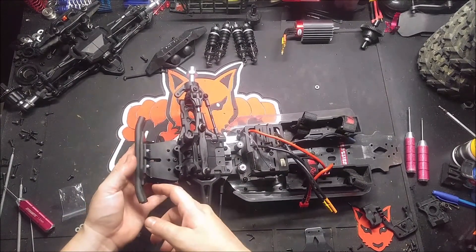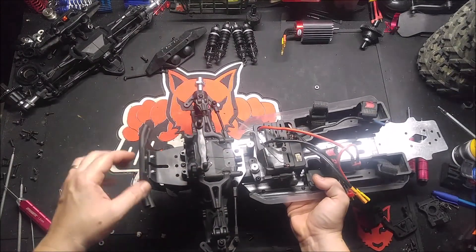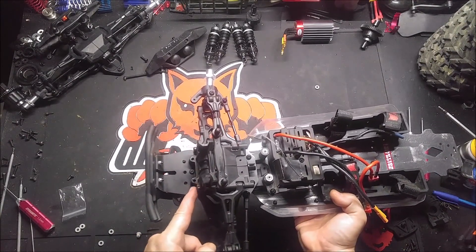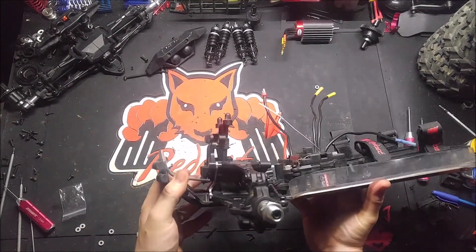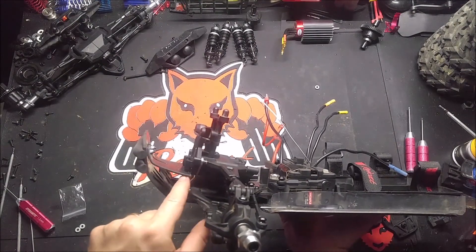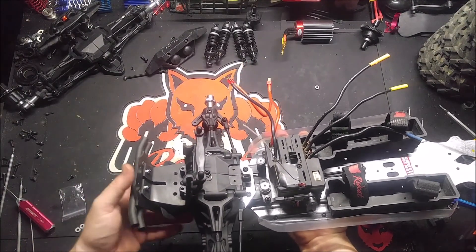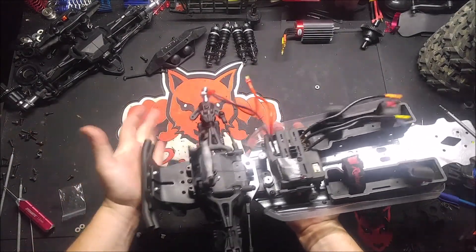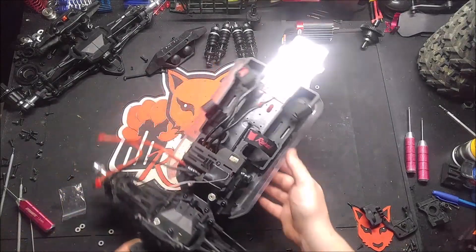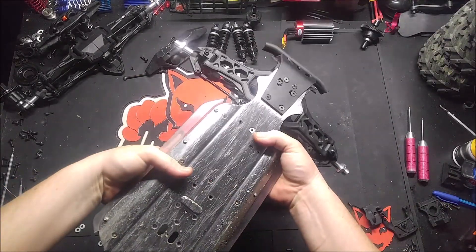I had to do some adjustments up here just in case anybody is seeing this and wants to do it before it's available. It's the TerraMotor 10 one with the double bar. I had to lower this here — the holes were originally here, but since that buffer is different I had to lower that down just to make it work, so I had to put a little bit longer screws here. Did the holes basically just move them all back all the way up against this. This is resting on that end piece. The difference with this is that buffer piece that comes down and attaches to the chassis is in the way, so this can't go all the way back. There's still plenty of room there. I mean, I can't explain how solid that thing feels right now. I'm looking forward to having that on there.